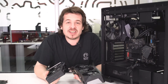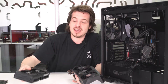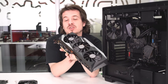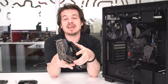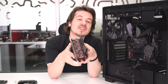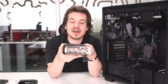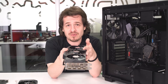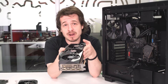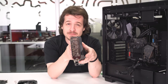What I really want to show you here is the difference in size between these two cards — we have a 2-slot 3050 and we're replacing it with a 3-slot triple-slot 3090. If you put it towards the back, you can see the case of the GPU actually extends past the PCI slot — something like a 2.5 or 2.9 slot designation. In these cases, always round up: if it says 3.5 slot, it's really using up four slots. Some really gigantic graphics cards are out there, so that's why I wanted to show you what it's like fitting one of these bigger cards.